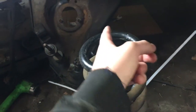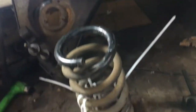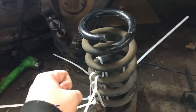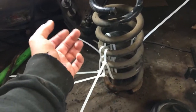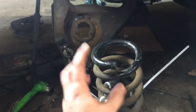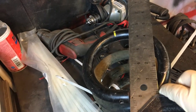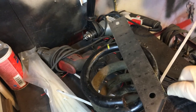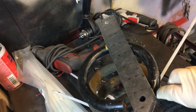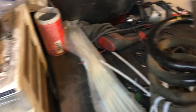The spindles are coming, and you always want to cut from the top of the coil. I'm going to grab my angle grinder and zip that off, then throw it back in. I'll put a jack stand underneath the lower control arm or put the sway bar back in to hold it. I made a mark, but I feel like I was being greedy. They say half a coil is good for an inch on a V6 truck — this has a V8 in it. I lined it up from the edge leaving a little bit there; that seems more like a proper half coil to me.